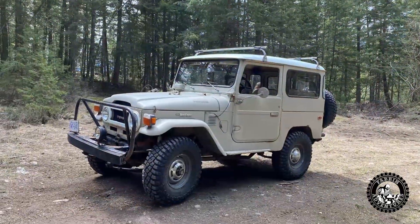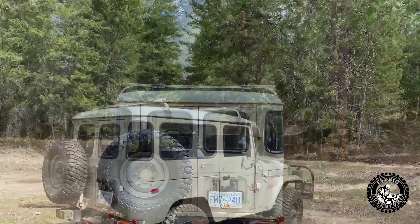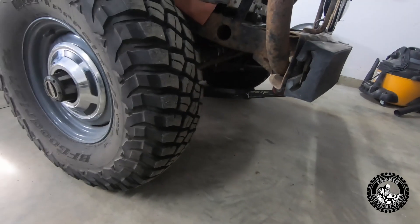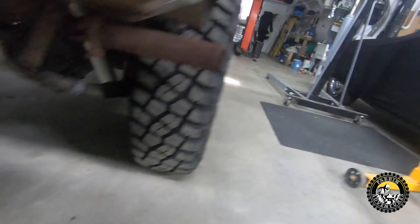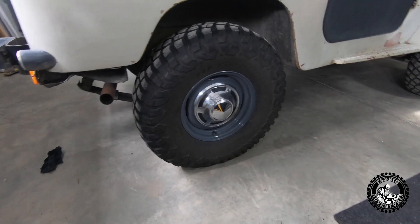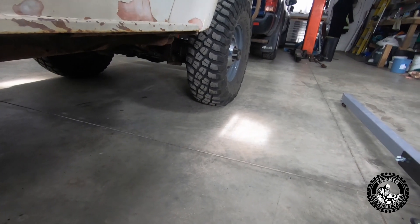Hi, Ron and Crystal. It's Darren from the Car Next Door YouTube channel in Salmon Arm, BC. This is my submission to your subscribers rides — it's a 1975 Land Cruiser FJ40. We'll start from the bottom up on it. I did a two-and-a-half-inch Pro Comp lift with Pro Comp shocks just to get it a little bit off the ground. Riding on 33-inch KM3 BF Goodrich tires and original rims and hubcaps. The rims were a little skinny so I'm pretty happy I picked the skinny tire to fit on them. Lots of traction — not on ice, but definitely on snow and mud. These things dig.